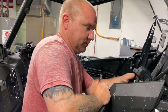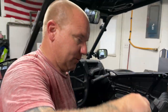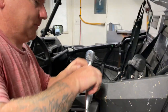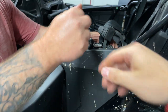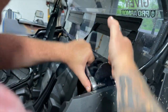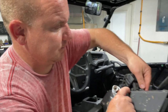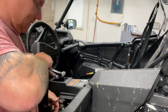There's another bolt I've got to get rid of. This is a 17 up here, a 19 down below, and it almost looks like a 12 or a 13. So you're going to need a 19, a 17, and a 13 to take this seat belt off. Was it spinning? Yes. Still spinning? Got that loose — we're going to take this out. That's that rubber piece that holds your seat belt. It gives you a little flag, so looks like I'll be road cruising with no seat belt, which is whatever.